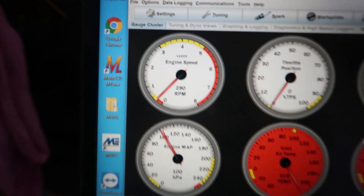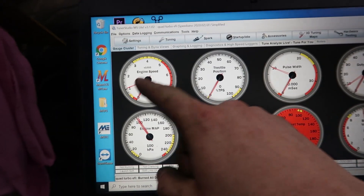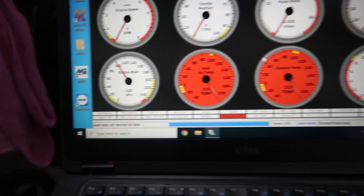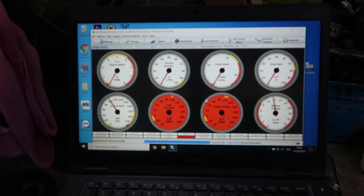Yes guys! As you can see there, we've had a bit of pulse duty cycle, so that means if the fuel injector was hooked up that would have worked - that's absolutely awesome. There's a wee spike there but I've seen it cranking over around about 300 RPM. So everything looks like it's going to work. What I'll do now is hook the coil up down here and we're actually going to see if there's a spark. And if there's a spark I'm going to be absolutely buzzing, because this sort of thing doesn't normally happen straight away - you always have teething problems. This is why I've done it so rough and left the wiring very basic. But seeing that RPM signal, that's a good sign.